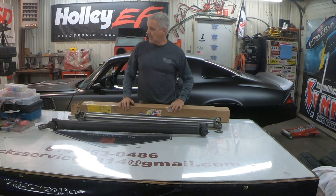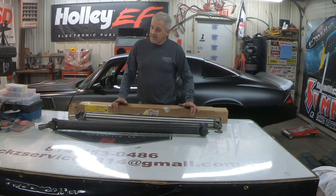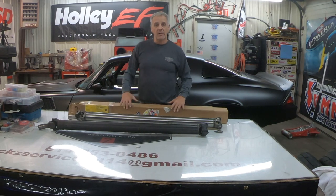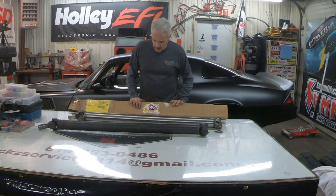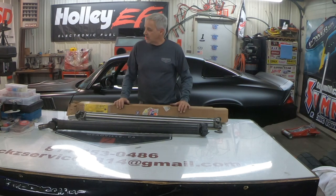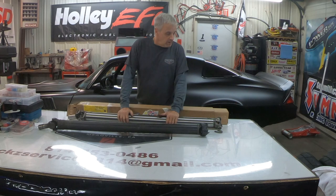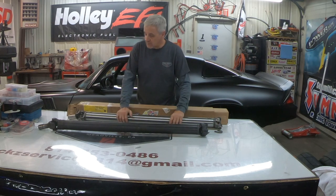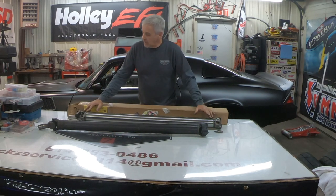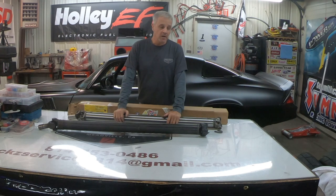With the center section bolted in, the next thing is the driveshaft. In my case the driveshaft was too short, but if you're switching rear ends it'll end up either too short or too long. I went to Speedway Motors and got one of their Fast Shafts. Speedway promises a quick turnaround and a high-quality product — I gave them a try and I'm happy with it. It came back quickly, it's a bigger diameter than the original, everything is more heavy duty, it's balanced, and the welds are very professional.